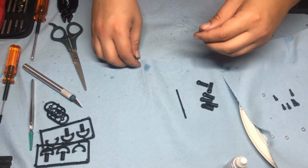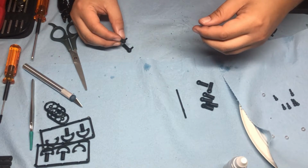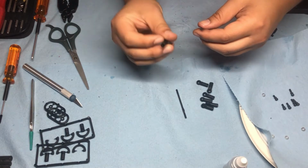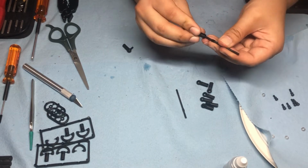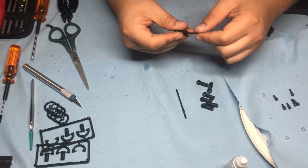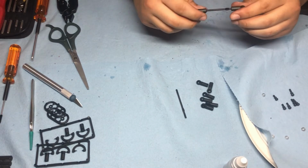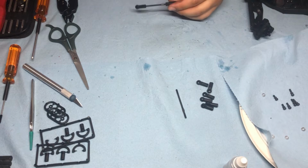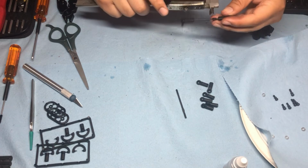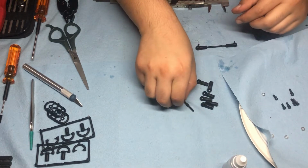Okay, so on the right hand side, you want to install the shorter of the 2 ball studs, so it's going to have the 6mm thread. And on the left hand threaded side, you're going to install the 8mm thread. The camber link, or the roll center link, needs to be 35.7 millimeters from shoulder to shoulder. I can do the next one.